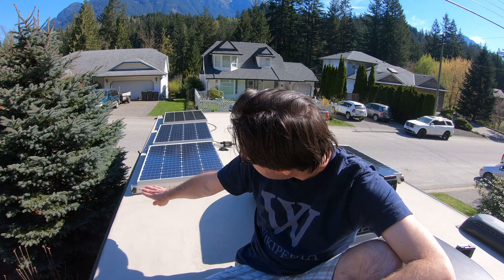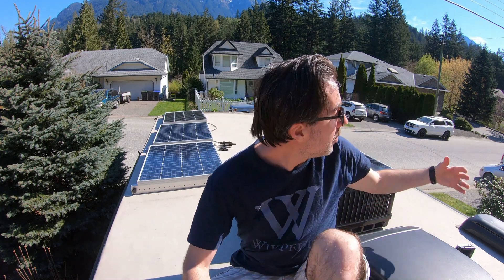With a little experimentation I was able to determine two things. One, the roof is a lot flatter towards the edge, so I think the panels are going to go best right at the edge. And two, I don't think I really want them oriented the other way, because then they'd have a big space underneath where air can rush and possibly create lift — you really don't want that. Oriented this way they're actually blocked from the air, so there's not going to be air rushing underneath when driving down the highway at 100 kilometers an hour. I'm thinking I'll line up three on that side and put the other one on this side.